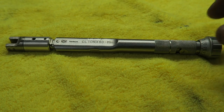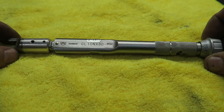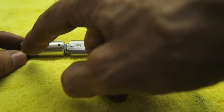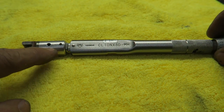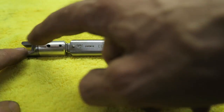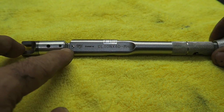To adjust the spoke torque you're going to need a torque wrench. I use this one made by Tonichi and I set it to 5.4 Newton meters. I'm using a 6.8 millimeter head made by Fast, and I had to make an adapter to convert the Fast fitting to my torque wrench fitting. One important thing if you decide to make one yourself is you need to space the head the correct distance away from the torque wrench — I looked it up on the data sheet of the torque wrench to make sure this is the correct distance.